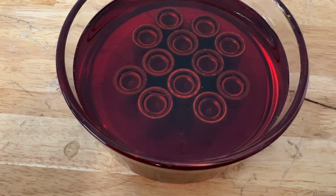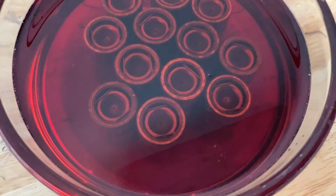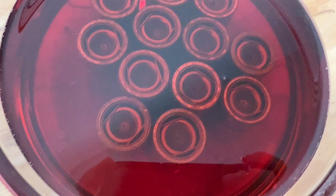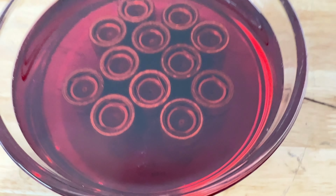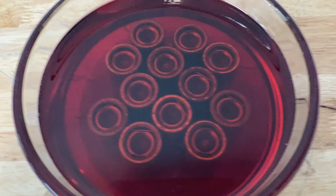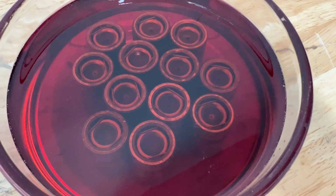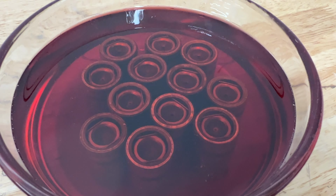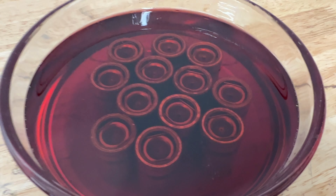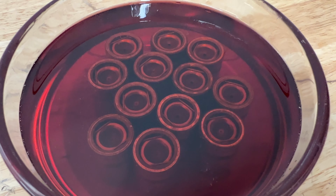All right, after doing a little bit of research on the lifters, you want to make sure that they are facing up to let the bubbles out. If you are going to bleed them, some people actually charge them up, but from what it looks like, the OEM and this manufacturer do not recommend it, but you can see those bubbles coming up. So these are getting bled. I'm going to let these sit for probably overnight and get back to you in the morning.